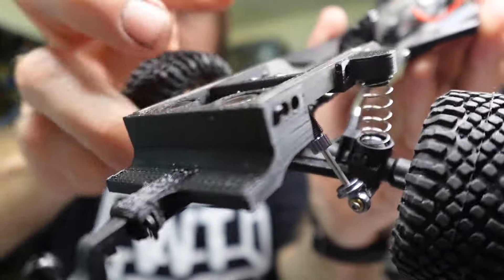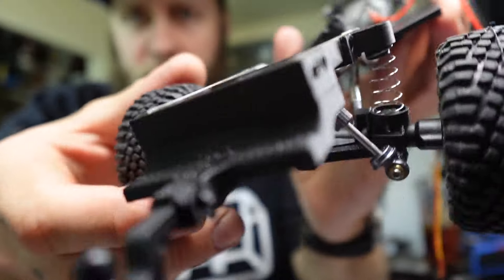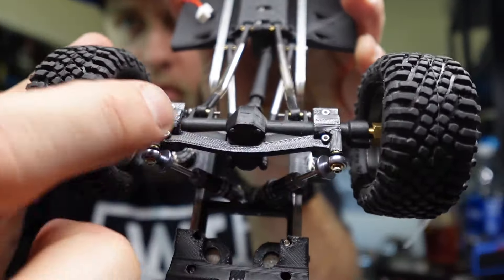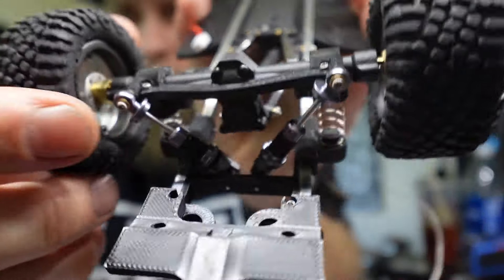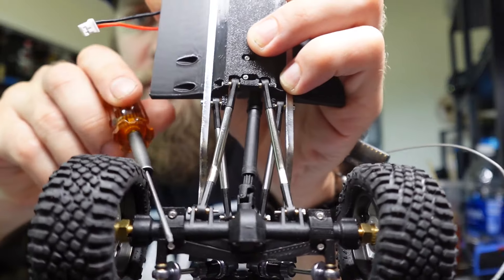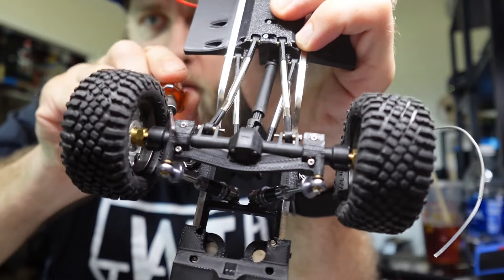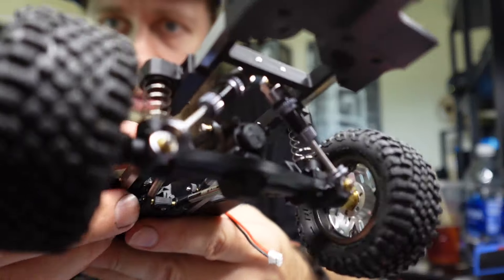The rear suspension has an upper and a lower spring bucket. The upper spring bucket mounts to the rail, and the lower spring bucket is like a clamp — with this whole bottom piece clamping it to the axle. Before this is installed, you have to attach the links to the axle first, because you can't get to this bolt with the clamp piece in the way. So you need to put on your links first, and then all this stuff. You can just look at it to see how it attaches and works.